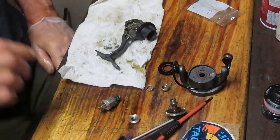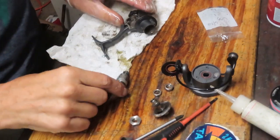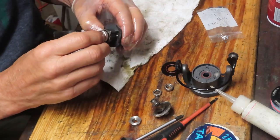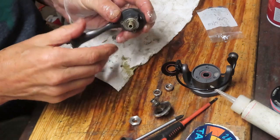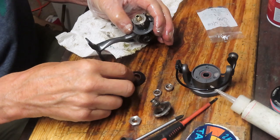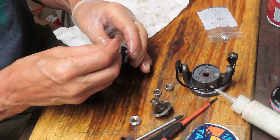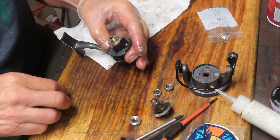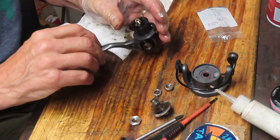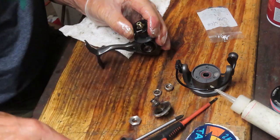I've got to turn the camera off for a moment to see if I can match up that bearing we removed that didn't come with the package. I was fortunate I did have a replacement bearing for that. Let's take our assembly after we've cleaned the case and put it back in. Make sure you're on the stud — you wouldn't be able to get it in if the pieces aren't aligned properly. Now we have this little o-ring assembly, and we want to get those three screws that belong to this.